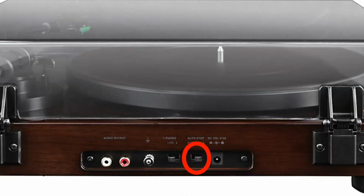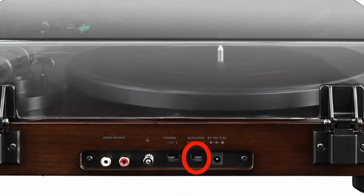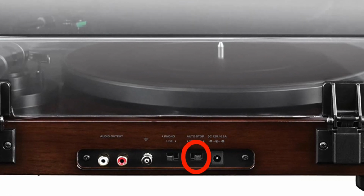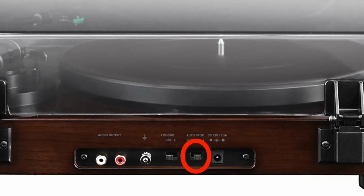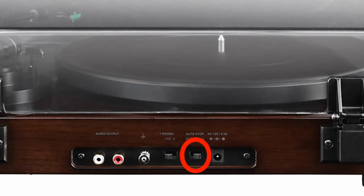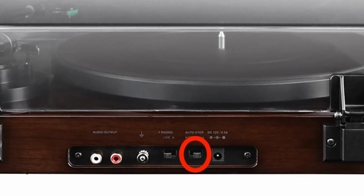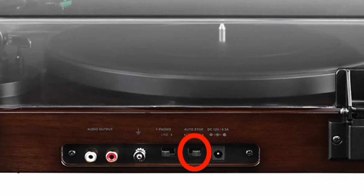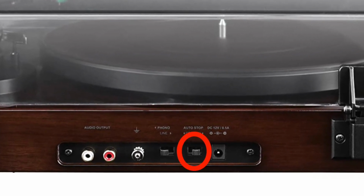The second reason I would call the RT81 a lifestyle turntable is because it features a semi-automatic drive action. I say semi-automatic, but this feature is more like quarter automatic. A true semi-automatic turntable will lift the tone arm at the end of the disc's play and then return it to its arm cradle, not the RT81. The RT81 allows the stylus to reach the end of the record and then it switches off dead.